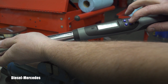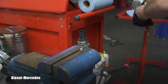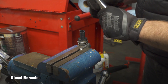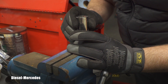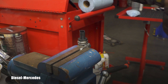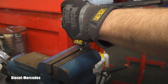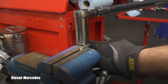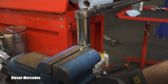Somebody did share that it should be torqued to 70 Newton meters — 70 — which sounds about right based on the torque I used to remove it. Here's the 27mm deep socket. I just want to make sure I don't damage the plastic but it seems to be staying clear. I have this Snap-on big torque wrench set — let's see what 70 Newton meters feels like.